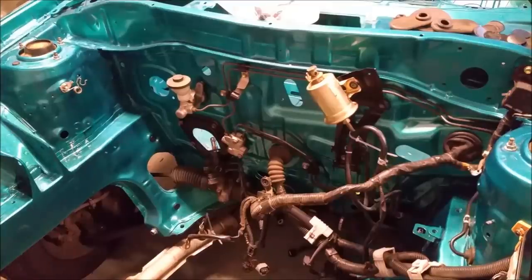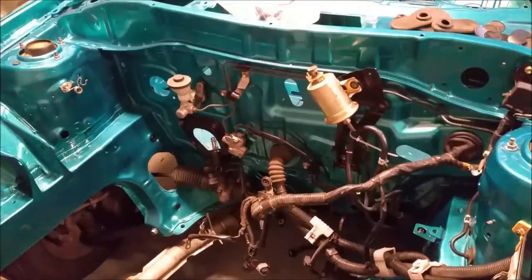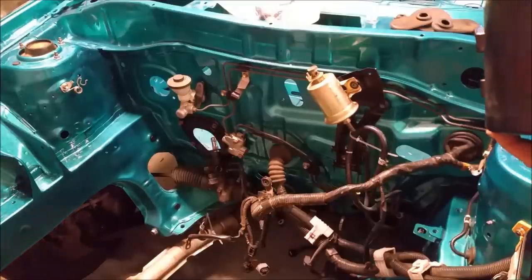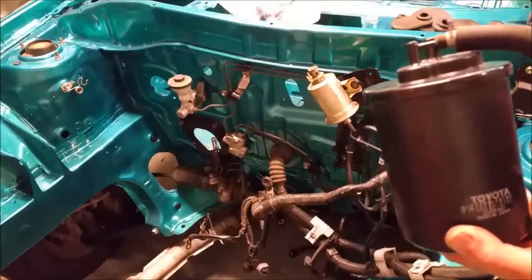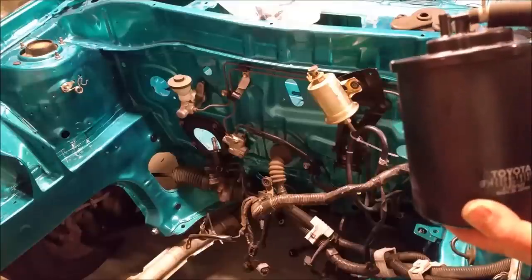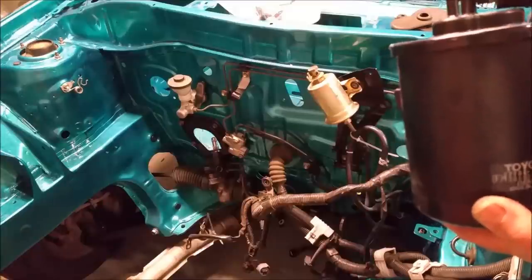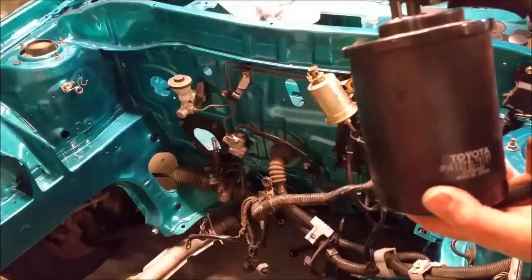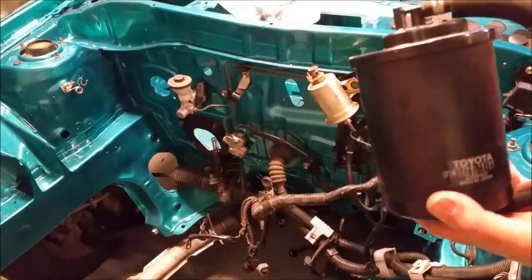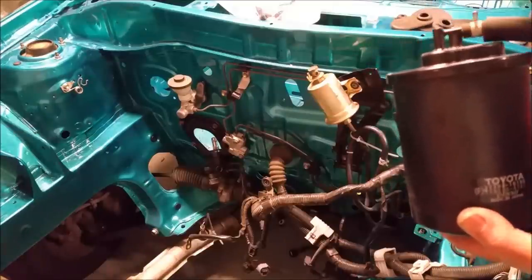These next bits have to do with the fuel system. Here we have a canister, and this canister is just full of activated charcoal. It's basically a granular component that will soak up nasty gases, but it will get to the point where it saturates. Now, in the case of a car, this is ported via that pipe down to the fuel tank. The fuel cap's sealed. In the early days, a fuel cap would have a vent in it, so as fuel expands and contracts in the tank, those gases would escape into the atmosphere. But the tank's sealed, the cap's sealed, so any expansion will come up through this pipe, sit in the activated charcoal, out of harm's way. And once the engine's started, it's ported by that into the engine where it's burnt.